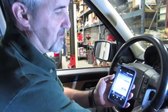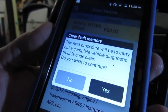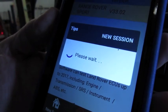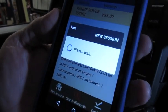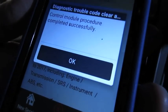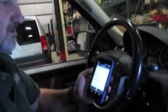So we're in the vehicle — it's told us to shut the ignition off, the vehicle will settle for a second. Now we've gone to a window and it'll take us through a procedure where it's going to do a complete vehicle diagnostic trouble code clear. It'll ask if you want to continue — obviously we want to clear any codes we may have incurred using this process. It says switch off, switches off, and switch on. 'Control module procedure completed successfully' — so we've cleared all the fault codes. It tells you to turn the key off, and that's it. We've done a height calibration on our vehicle and we're ready to roll down the road.